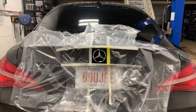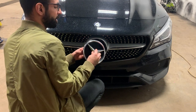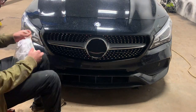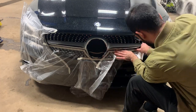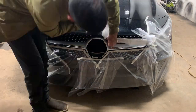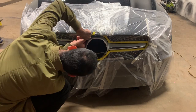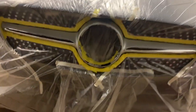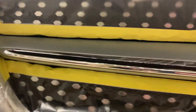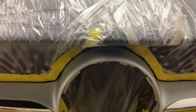We're going to go to the front of the vehicle and mask up the grill. We're going to be taking off the front emblem — I've got it loose already. Twist to the left, pull it out; it comes out in the center. The emblem just pops out just like that. Let me show you how the grill looks now — it's all masked up. The yellow tape is as close as possible to the edge without touching the grill. A little bit of the plastic grill still shows but it's not a big deal; it won't make a difference after it's all said and done. It's all masked off inside too.